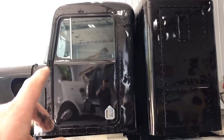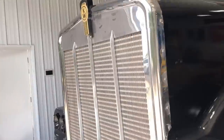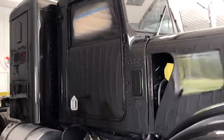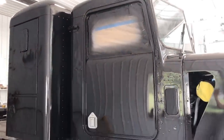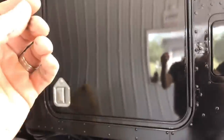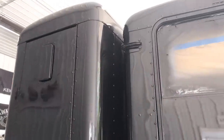I could have done one of two things. I could have sanded it with 320 and tried it again, but then I thought, well, before we do that — that's kind of giving up. Maybe we could salvage this. I've been watching a lot of videos on cutting and buffing. In a lot of cases, paint jobs need to be wet sanded down a little bit with some super high grit, like 1500 or 2000, to get rid of orange peel or any little bits. Then buff it down with some rubbing compound, polish it back out, and wax it. So I'm going to give that a go.